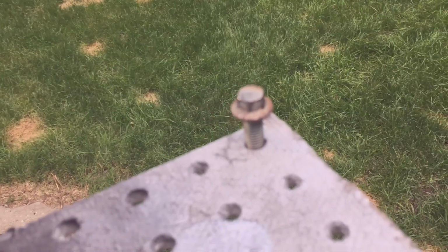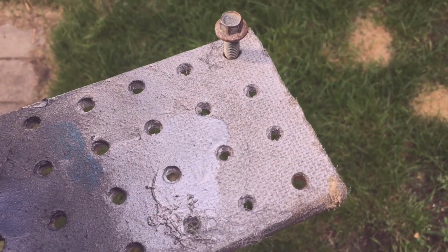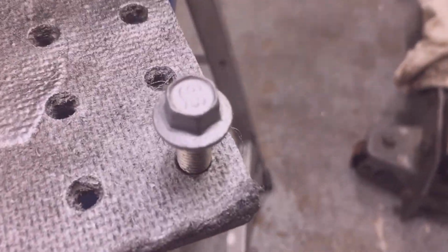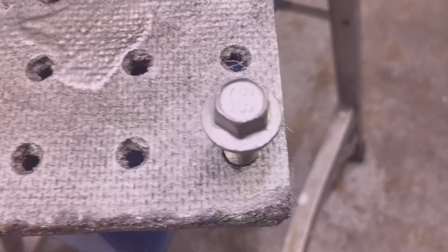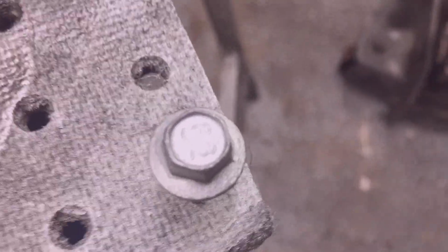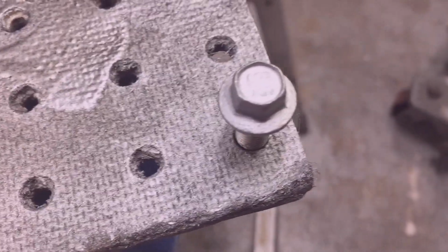That bolt I just hit with a wire brush and then a little lacquer thinner. And this is what a scrap piece of pegboard comes in handy for. And spray paint that silver. So take a look at the bolt after I heated it in the oven. So it's got silver engine paint on it that's been heated at 250 degrees for about a half an hour. See how the paint has shrunk down. You can clearly read the letters. I should have applied a couple more coats of paint. See how it's kind of weak on the edges, but it's for a quick job.